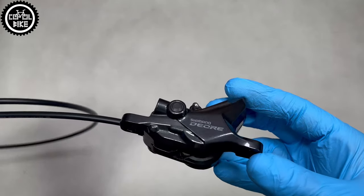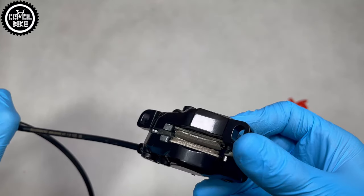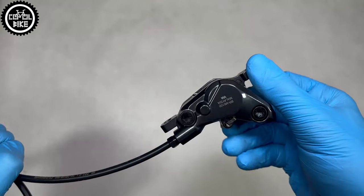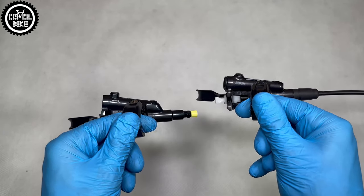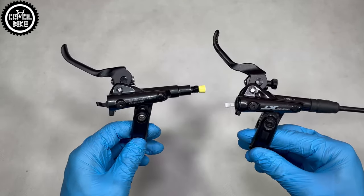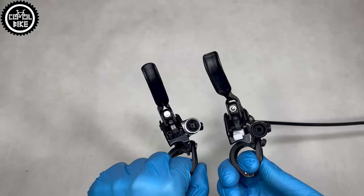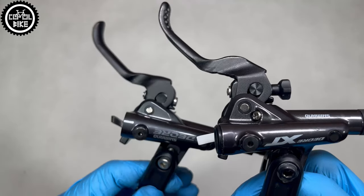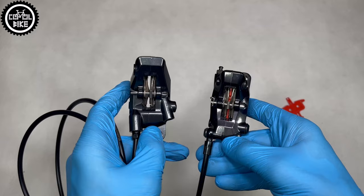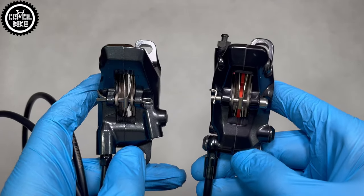Material differences include steel pistons instead of ceramic ones — yes they can rust but they won't break. The same lever position adjustment is there but instead of a convenient knob you need an allen key. The brake lever is simple and not like an XT forged part with finger holes, but still you can live with it. The same applies to the cotter pin instead of a bolt.